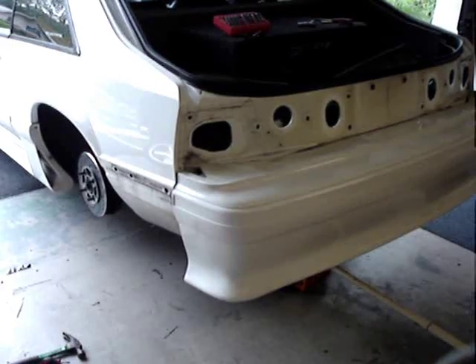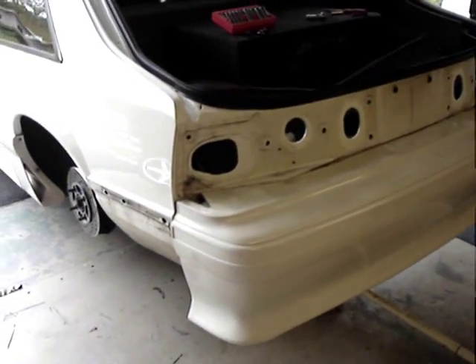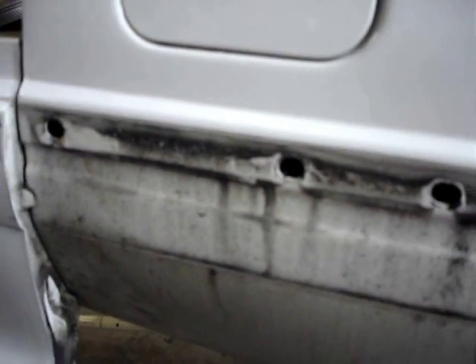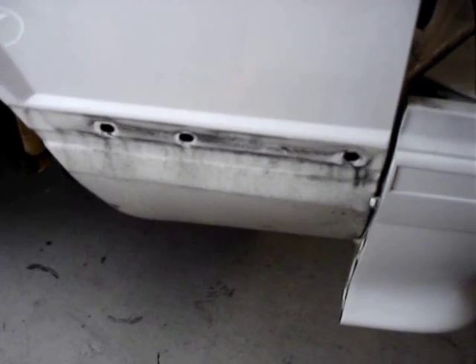I jacked up the car. Here's a recap of what's going on — I take back what I said about it being easy. It's not that difficult, but it's time-consuming. Over on the gas tank side, you've got the gas tank filler tube, which is in the way of everything. For the side panels, to take these off you've got two underneath on the inside, three along the top, and two that bolt into the wheel opening molding. I removed the wheel so you can get to it easily. The bumper is detached all the way across — those were the nuts on the inside, four total, one on each side.